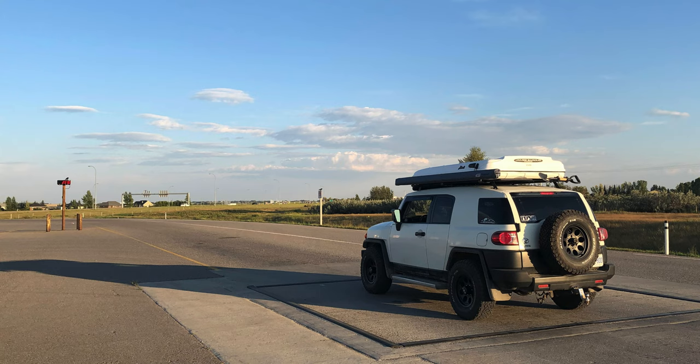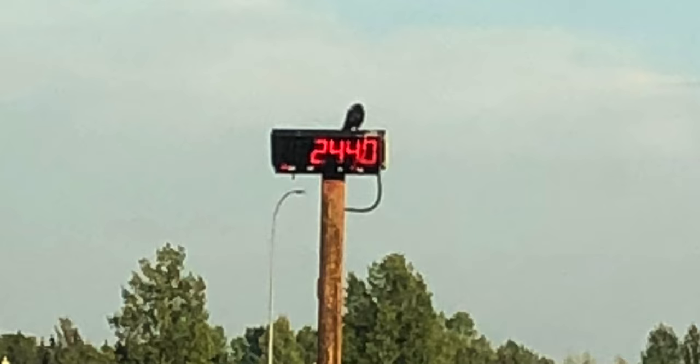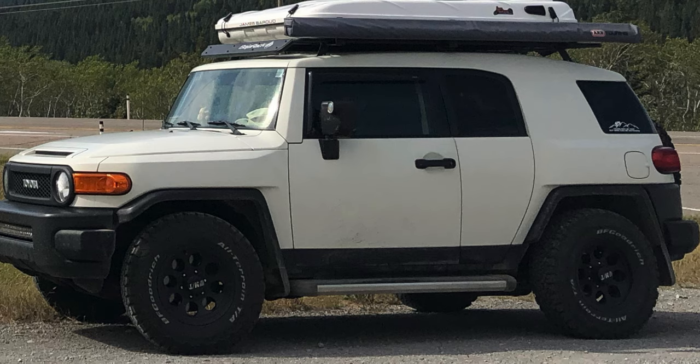As you can see here, in 2018 my vehicle weighed in at 2,440 kilograms, which is just under the maximum GVM. All engineering specs are designed with a factor of safety of 1.5, so I was well within the limit. But don't push it — you don't want to be that close. I was still running the stock springs and shocks, so naturally they were struggling. I was carrying too much stuff.